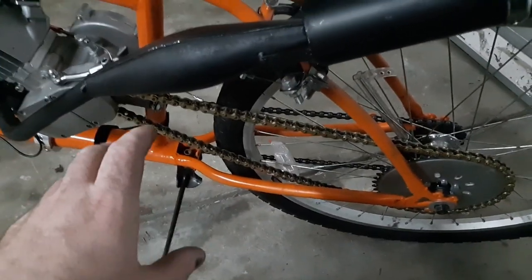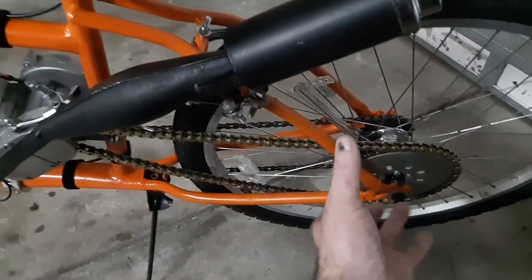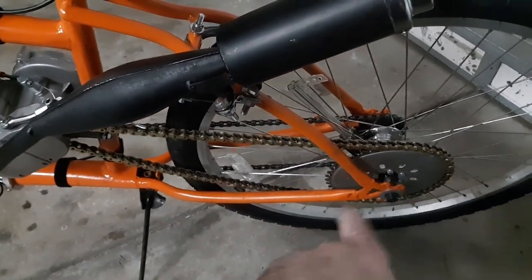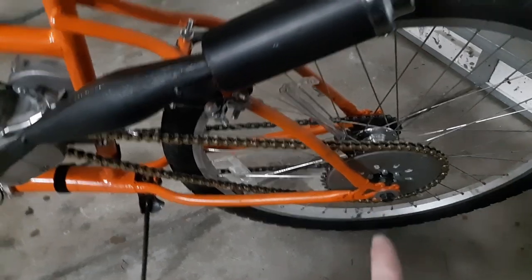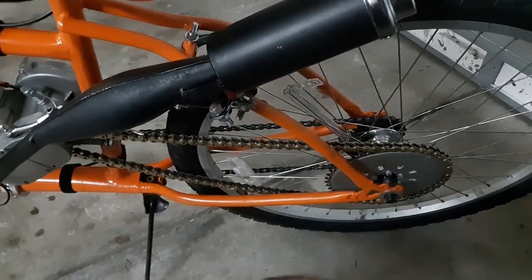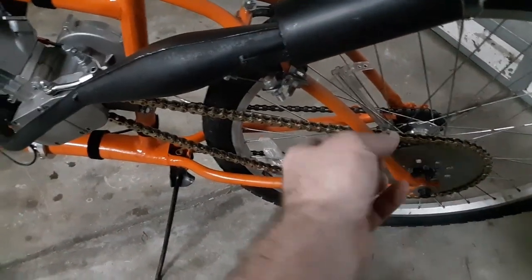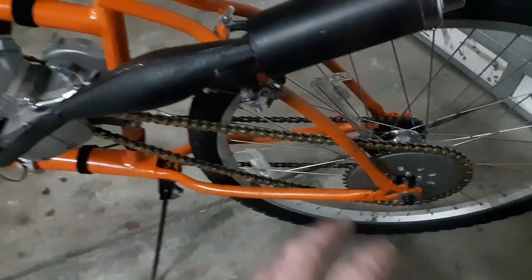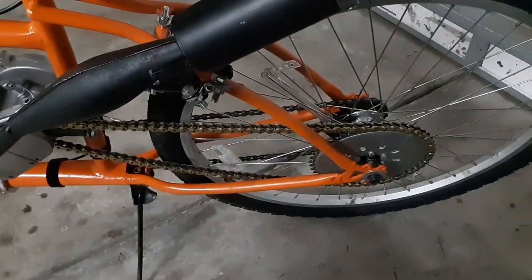So the second problem I've had tons is I'm shearing all the bolts off. They just literally turn and it shears the bolts right off. So I have the titanium ones in right now. So far it's been holding. It goes straight through the hub and they're bolted up. So not bad. That's been working. They're actually put in, tapped, and then lock nut. So I don't know, I'm kind of scared to put a smaller sprocket because it'll just, I don't know.